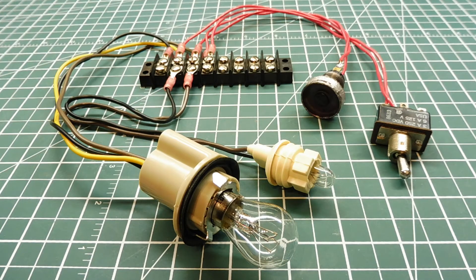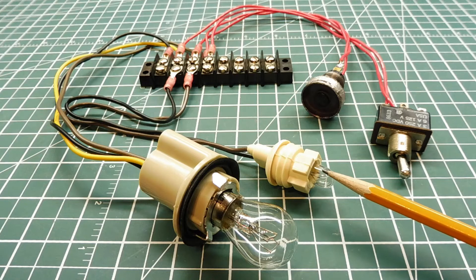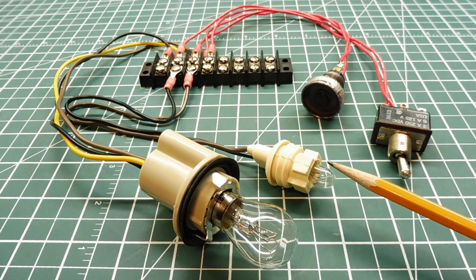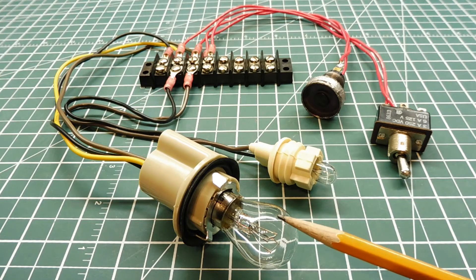So what's the key to this mystery? Well, the key is the bulbs. Every bulb has a filament, and every filament has a resistance. The resistance of the filaments in the 1157 bulb is very low in comparison to the side marker bulb. The side marker 194 bulb is a lower wattage bulb, so it has a higher resistance — we can call it a high resistance bulb and the 1157 a low resistance bulb. Because of the difference in resistances and voltage divider circuits, the engineers used this to their advantage to build the GM blinking circuit.